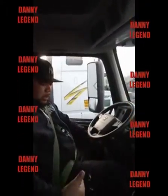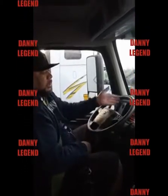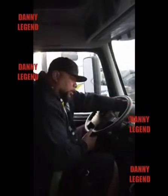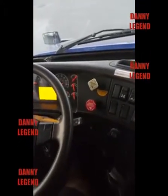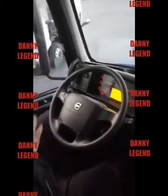Now I'm gonna go right into my brake test. I'm gonna leave it in low gear, leave my brakes disengaged, turn my truck off — not gonna touch nothing — turn it off, get off my brakes, get off my clutch, and turn my key back on so I can get my gauges to work. In the top right corner there is a number that says A — and A stands for applied. I'm gonna apply 90 PSI pressure. I want to make sure I don't lose more than the allowed PSI in one minute.